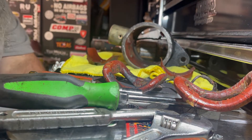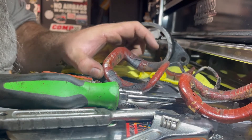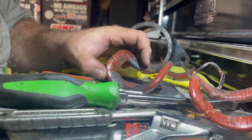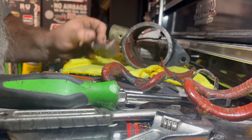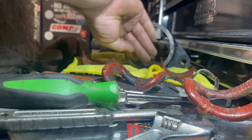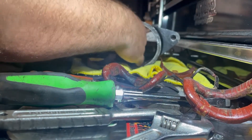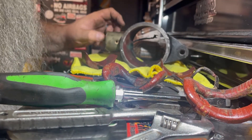So that's the field coils out. You'll notice on this one over here, this has got that wire that goes to this tab, and that tab gets sandwiched under here to create a ground to the outside of the case. One thing you just want to make sure is there's no extra debris or anything else in there — looks clear and clean.